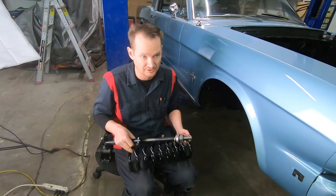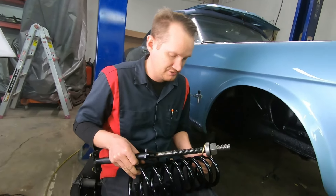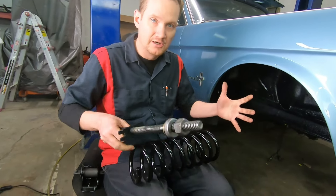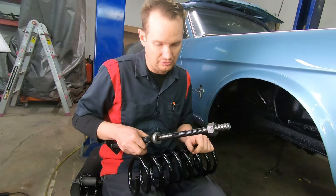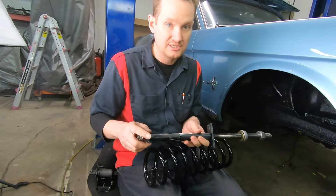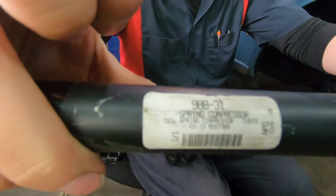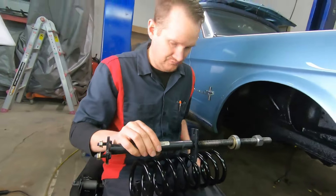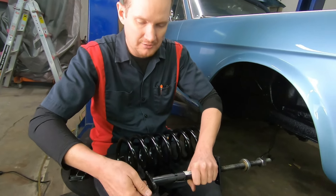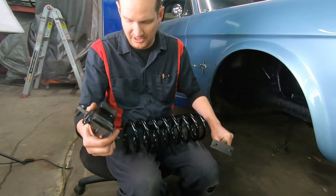The first thing I do is put the coil spring up in there because there's nothing in your way. If you just go ahead and put your control arm in the way, it's doable, but you still have to get this whole spring up in there. So I'm going to put the spring up inside, get it compressed, and then put in the upper control arm. The only tool I use for compressing springs is this tool right here — there will be a link in the description, you can buy these from National Parts Depot. What this does is it mounts in as if it's a shock absorber, mounting in the shock absorber location on the spring saddle.